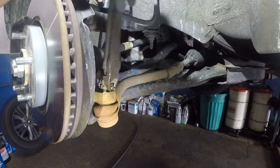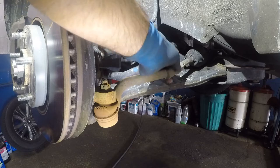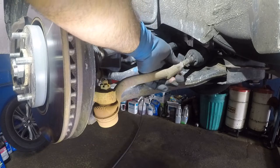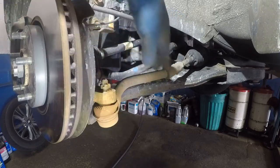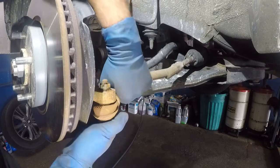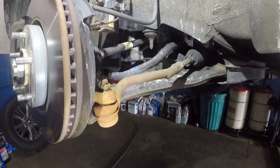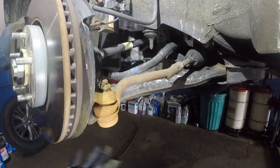So we're going to start off by taking this off first — that is out of the way. Then we're going to loosen up the bolt right here on the tie rod, because later on you're not going to be able to. Sometimes this is jammed internally so you can't even take that off. And we're also going to change the ball joint, but once we take this off you'll be able to maneuver this spindle around and we have a better chance of changing that ball joint easier.